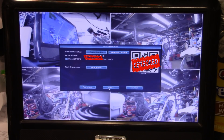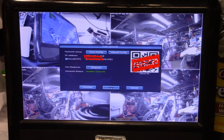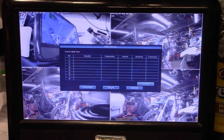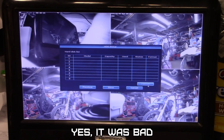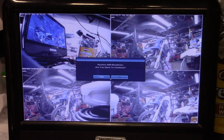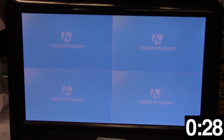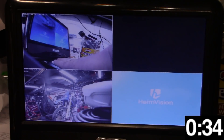The network is automatically configuring — healthy network. Next it shows the hard disk list and there's no hard disk detected — maybe the old drive is bad. I found a brand new 250-gigabyte drive; kind of small but it'll work. Let's shut down, swap the drive, power back on, and see if it detects it this time — that boot was a little faster.